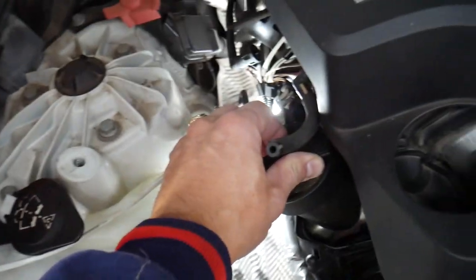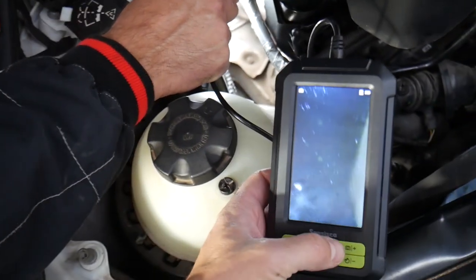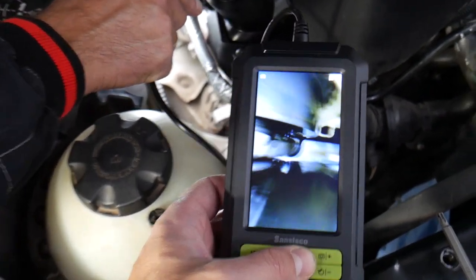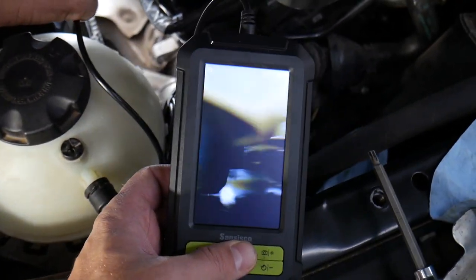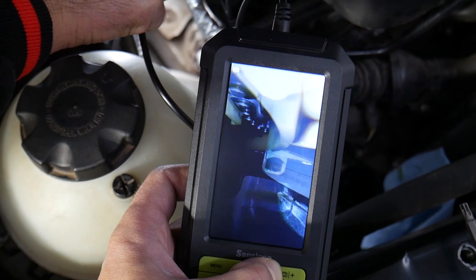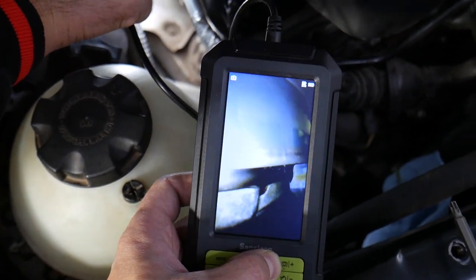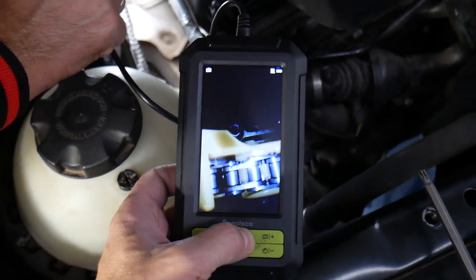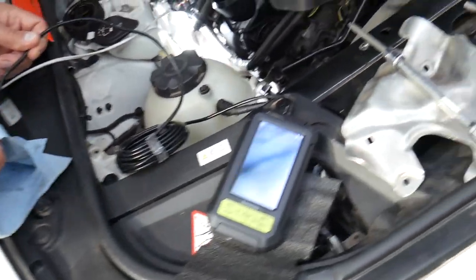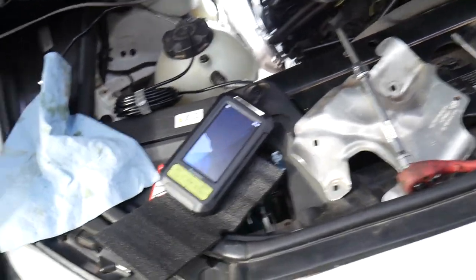Now let's do something else. I'm going to open the oil cap and inspect the timing chain components. Through the front camera, I can inspect the timing chain guides — that's a weak spot on those BMWs; they break at about 70,000 miles. We can come down inside and inspect everything. I can switch to the side view and you can see the chain and the plastic guide on the side. I can flip to the other side and check the front as well. This saves so much work — instead of taking the whole valve cover off to inspect the timing chain components, I just stick the scope through the oil cap. That valve cover would take me about an hour and a half just to remove for a timing component inspection. Amazing tool — I'd definitely recommend it.